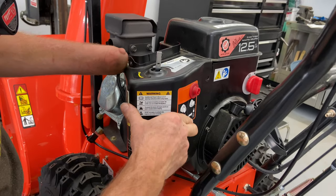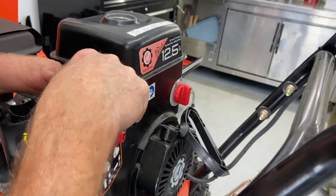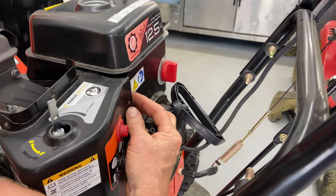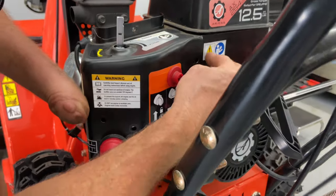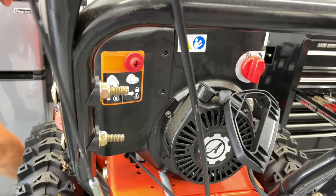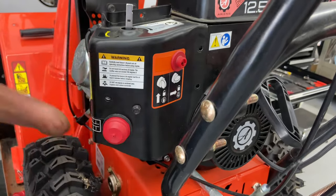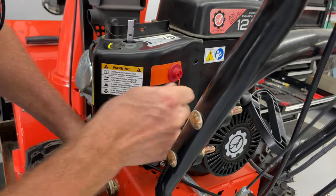That's going to go on like that. You can tell by the wear marks that this lip went underneath the fuel tank like that. And you can tell by the wear marks over here where our bolts were laying against this — so you know that this goes behind here. I'm going to start by putting in two on the carburetor side first, and don't tighten anything up until you get them all in so you don't have a misalignment. It'll help you line everything up.